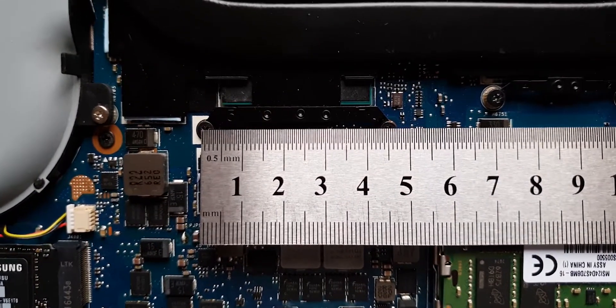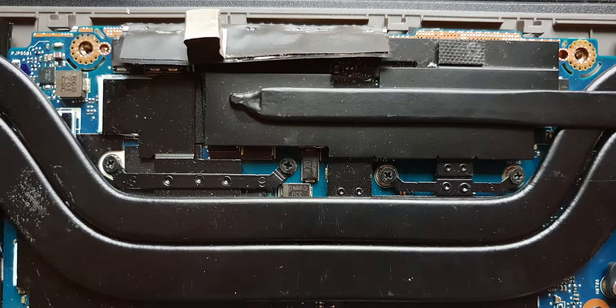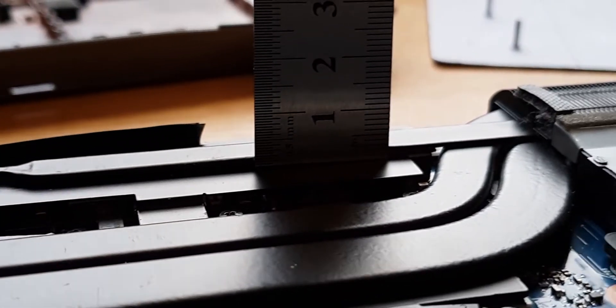Now we need more detailed dimensions. First, the distance between all of the screw holes — I won't be making the holes exactly the same diameter as the screw, giving me a couple of millimeters to play with. Secondly, there is a copper pipe at the top that's slightly raised above everything else. This pipe assists with cooling the CPU, so I'll have to implement a corresponding dent in the water block where it will fit. I need its position relative to an edge, as well as its length, width and height. Measurements are done — enjoy the timelapse. I may interrupt it to explain anything I didn't mention as we go through creating the 3D model.